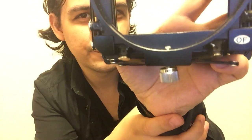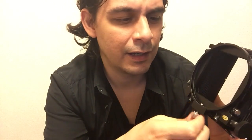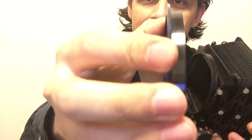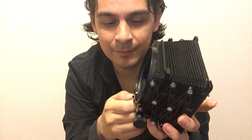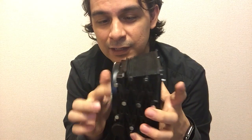The screw has a plastic cover right on top — a tiny white tip. If you drop and lose that little white dot, which is super tiny, and you're moving the lens without unscrewing it all the way, you can see it has a small nib at the edge that holds it in place. If that plastic bit pulls out and you lose it — maybe you're on grass and just can't find it — it's going to give you trouble because the screw will scratch and not hold well, making everything wiggly. That's actually why I upgraded from the G2 to the G3.